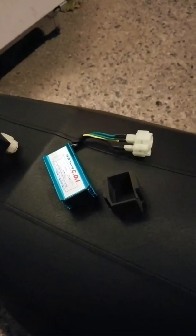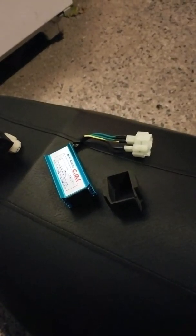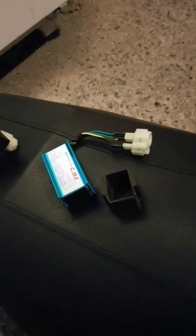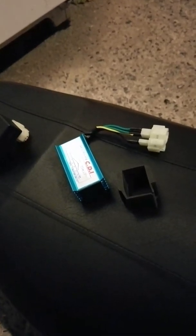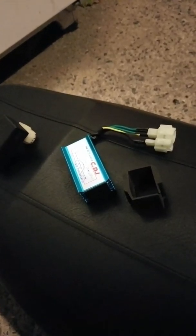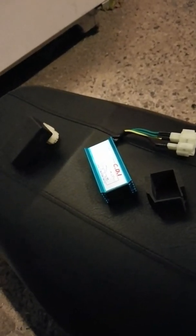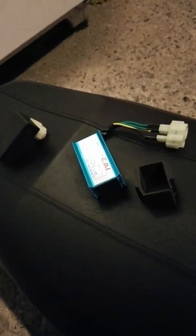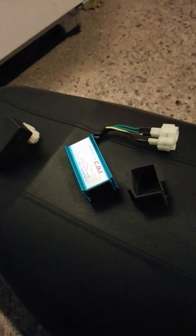On Google you can get two-tire kits — they're 120 by 90 by 10 in the front and 130 by 90 by 10 in the back. There are some Michelins, some Pirellis — there's a bunch. I'll probably go with a set of Kendas because they don't look too bad and from all the reviews I keep seeing, Kenda makes some good scooter tires. I want something smooth but reliable. If I build this thing the way I'm planning, I want to hit at least 50, maybe 60 mph.